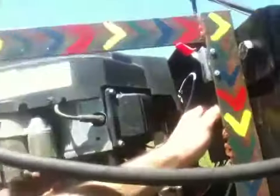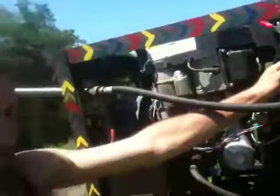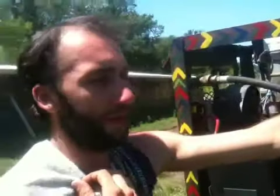And for the fan, I found the prong that — in the start position is dead, but in the on position it's hot. So when you crank the engine, you're not drawing power in two different directions — one for the fan motor and one for the starter. You're sending all the power to the starter. And then when you let go of that, the fan kicks on.